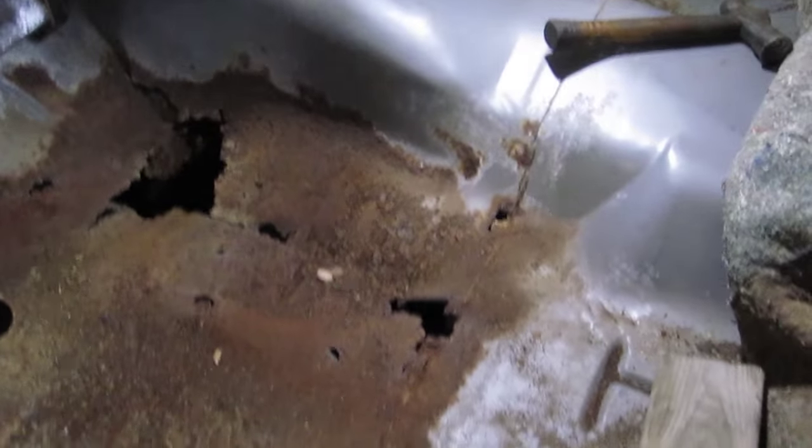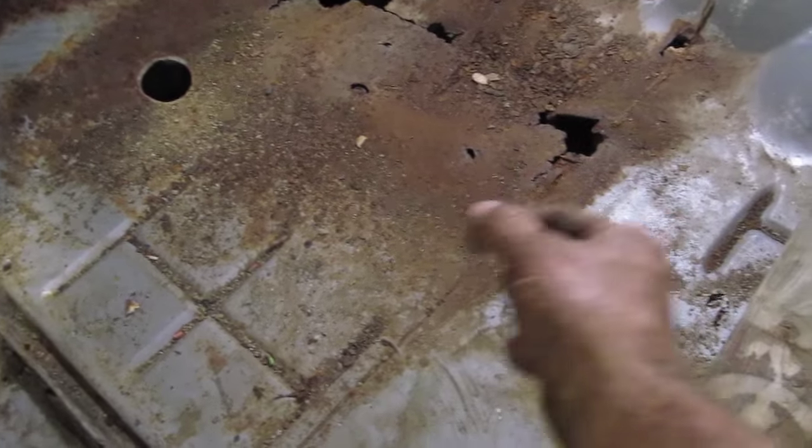Overlapping is easier because you don't have to be exact with your cuts — you can weld it on the bottom and on the top with less chance to burn through. We're gonna butt-connect though. The panel doesn't fit a hundred percent, so we're gonna cut out the floor and get it closed. It's pretty tight here, so if we cut it a little bit we'll have a little room in the tunnel and can drop the panel down nicer.